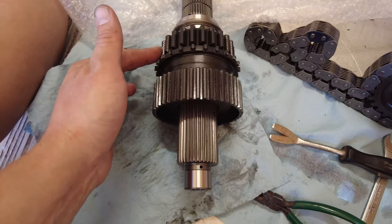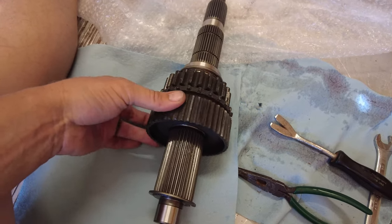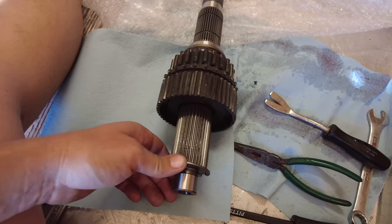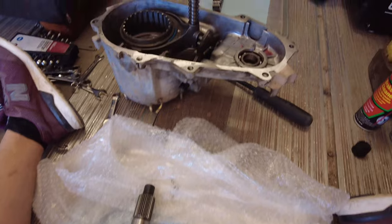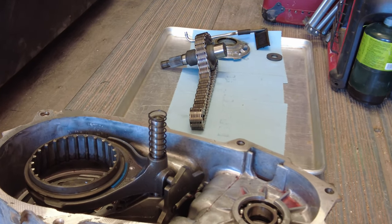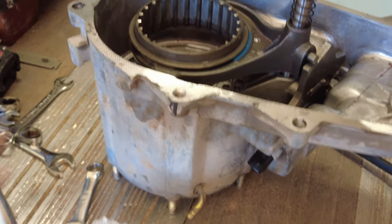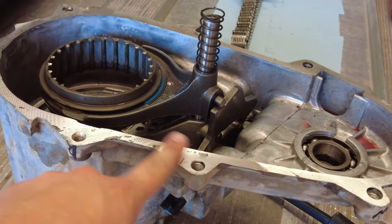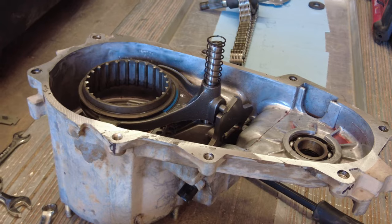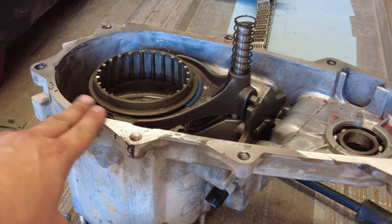Take this time to inspect your gears, all the gears inside, and the chain inside — make sure nothing's wrong. If you want to clean it all up, this would be a good time. I ended up cleaning my gears with some brake cleaner to make sure they looked all right and were free from debris. I wiped down the output shaft and completely cleaned the other shaft and chain with brake cleaner, then wiped everything down. With the larger part of the case, I'm going to wipe it down and then prep the surface with a green Scotch-Brite pad and brake cleaner to make sure it's really clean for the black RTV I'm going to use, so I don't have to do this all over again with a leaky T-case.